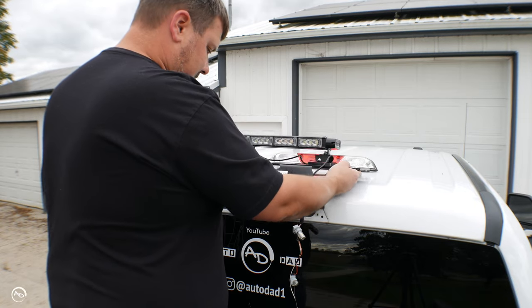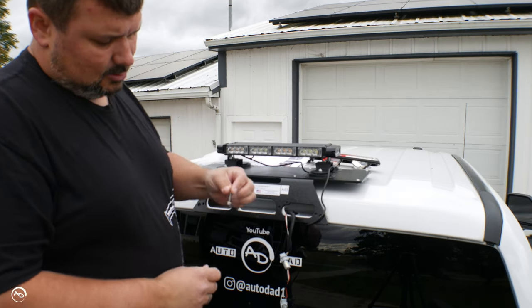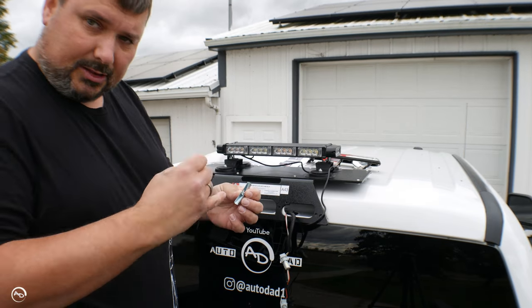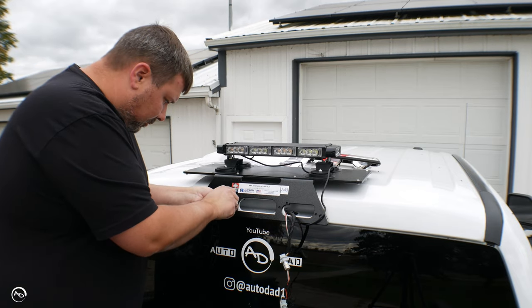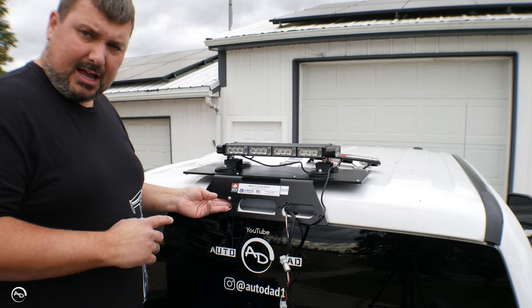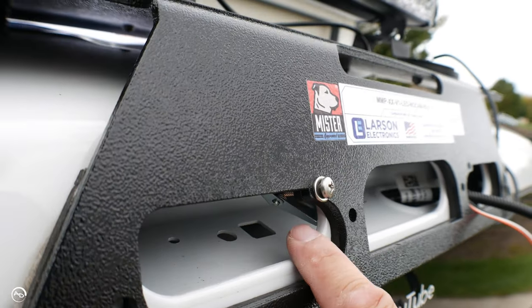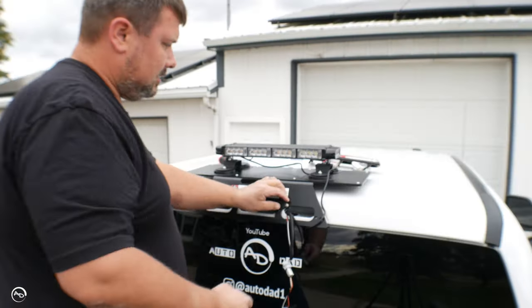Let's try and work some magic here. Line it up — I threw away the instructions, okay. You've got a washer and bolt, and then the anchor goes in like this so these go together just like that, and then this sits on the inside of the cab. Fish the bolt through — there we go. So there's the bolt, here's the anchor — you can see how it's grabbing a piece of the cab. I'll hold it there while I tighten this, and then do the same thing on the other side diagonally.